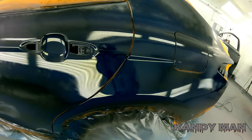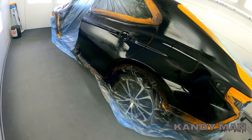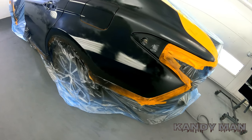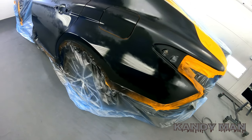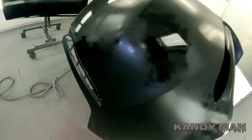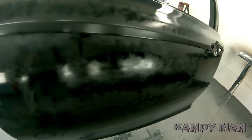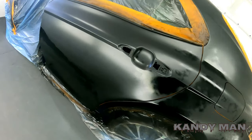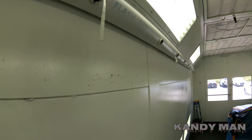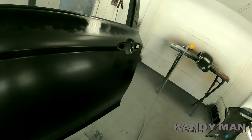You can see it already changing — the water-based on darker colors looks almost purpley, like a chameleon, when it's wet. Then when it starts to dry with the blowers on, you'll see it start to dull out as the water comes out. With the bake system and a little heat in the booth it kicks quickly. I have the heat at about 104. I honestly don't know which gun I'd pick — I like the digital gauge on the new one.